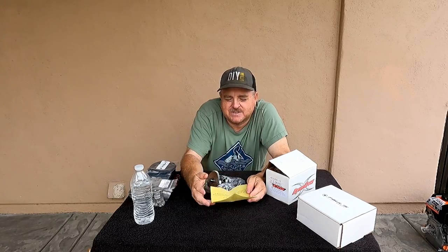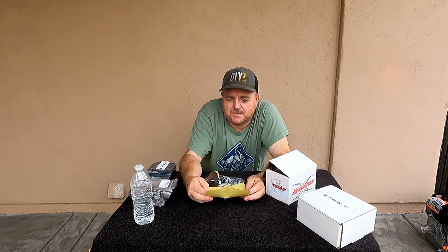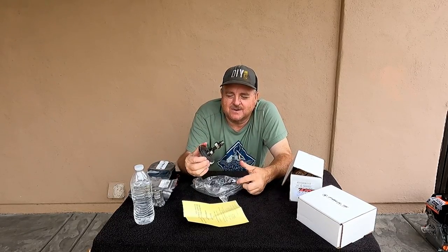So I've got the cam coming, and I've got a 2 degree timing key, so I can adjust the timing to give the 34 degrees. Also, that cam recommends 32 pound valve springs, so I have those coming as well. Unfortunately, I had to get them from different places, so they probably come at different times, because the one place I bought the cam from, I believe was OMBwarehouse, they were out of the 32 pound springs. So this cam, I believe, recommends 22 pound springs or 18, something like that. And well, I got that covered. If I decide to go that way, I've got that. But I think I'm gonna go with the 308 cam and the 32 pound springs.